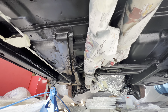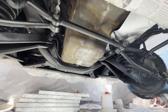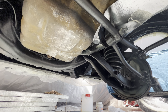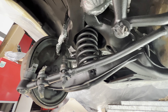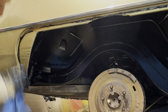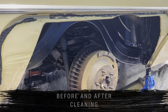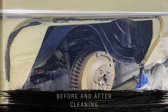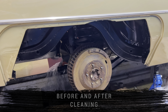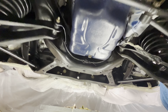I'm using these products. First to go on is Time Max Color — I use two coats: a grey one and a black one. Then I use UBS Clear, which is a clear undercoating. I use two coats, and then in the wheel housings I also use Time Max Body, which is a 2K BL protector. I sprayed one grey coat and two black coats followed by two transparent coats.